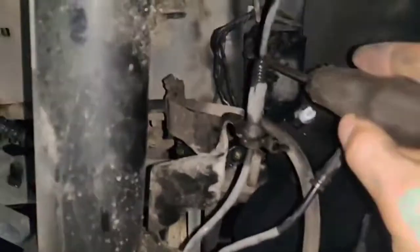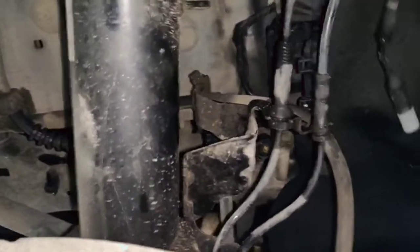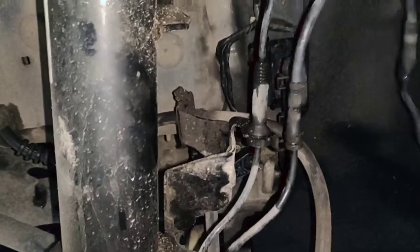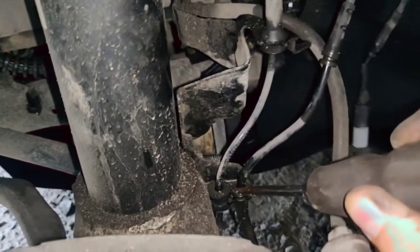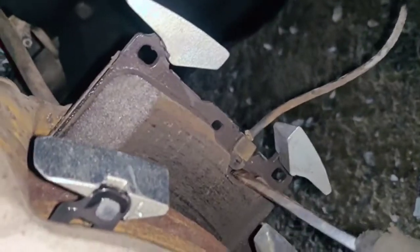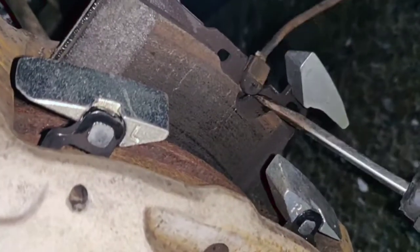This is the compartment that you have to open up in order to find the brake sensor connection, and here is the bracket that it connects to. Just take a flathead screwdriver and push it out — and then there is another one right here, also push it out. Then you take the screwdriver again and push the sensor out from the brake pad like so.